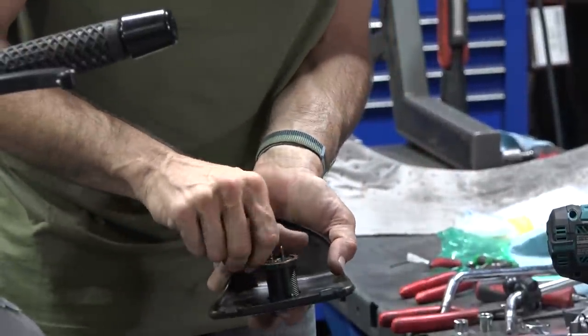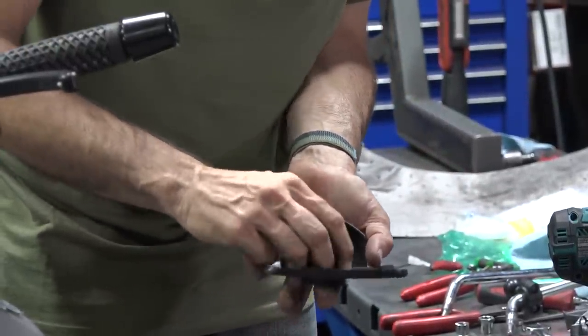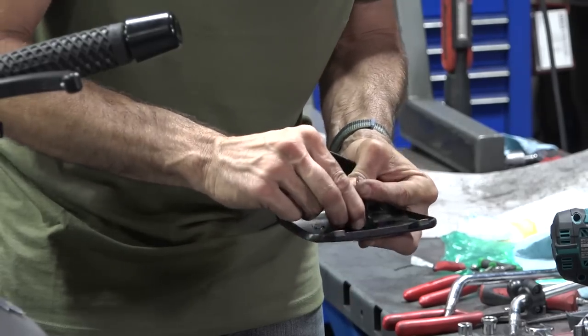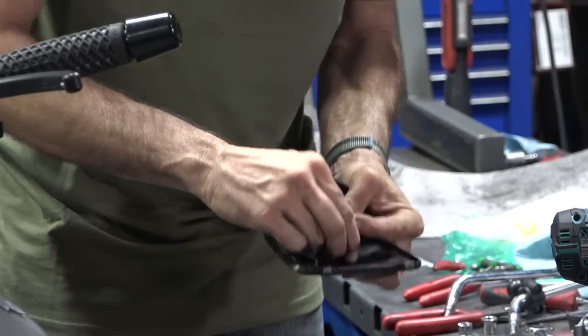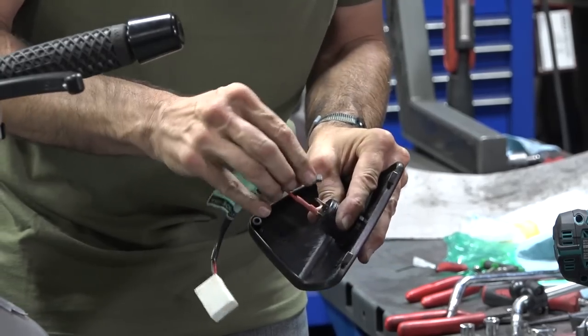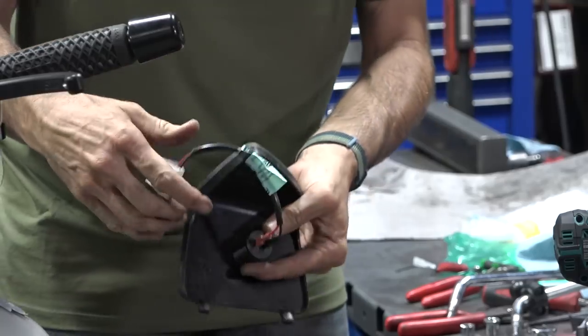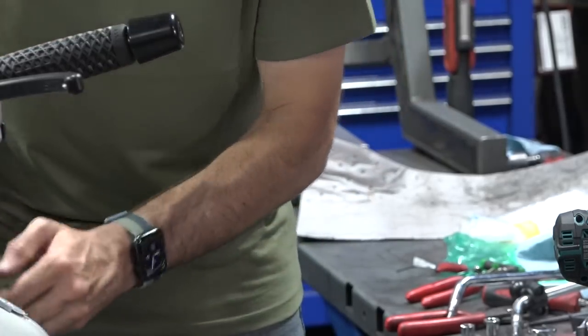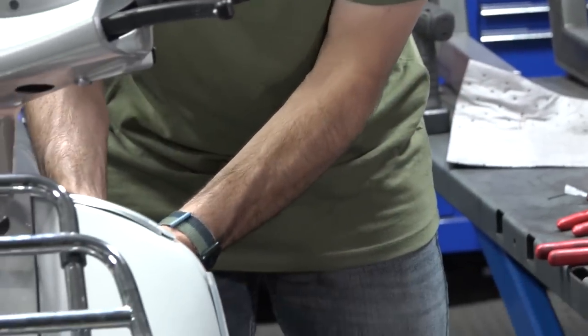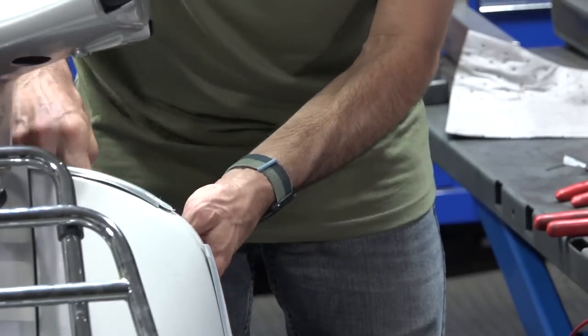Close up that little cover and now we have a USB charger. We already have the wiring harness, so thread it in place and use that same 12-volt wiring harness — it's just fine for this. Red on positive, black on negative — now we have USB power. If I'm going to go on a longer trip and need my phone charging or a GPS, snap that back in place and put the screw in.